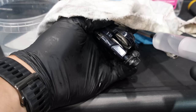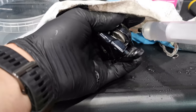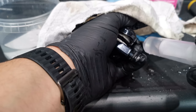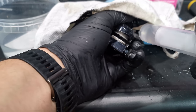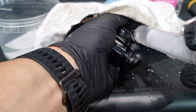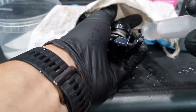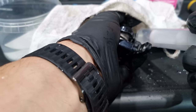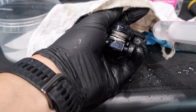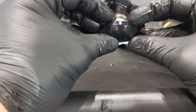Just working on those pistons — you see they go back and forth. So just push and release, do some exercise with it, and finally you will see water leaking from behind those pistons, which means they left their place in the caliper. But that won't be done just yet because they go against each other and you cannot remove any of those just yet.